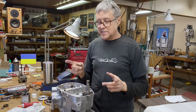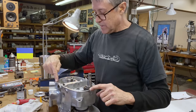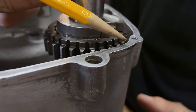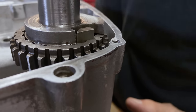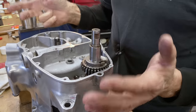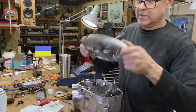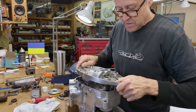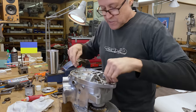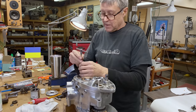I got two gasket sets which I bought brand new, and there is no gasket in either one for this surface here. If you look at the surface, you can see it's not really even — it looks like there's a low spot in the middle. I had to check that there's end play here because I'm not using a gasket. Let me show you the procedure — we still have to put a bunch of stuff inside, but I'll show you the process of checking end play, because it's pretty crucial that you get some end play but not excessive.